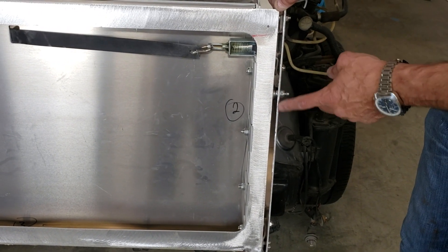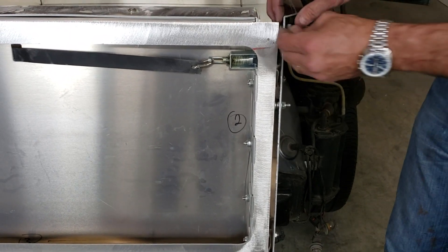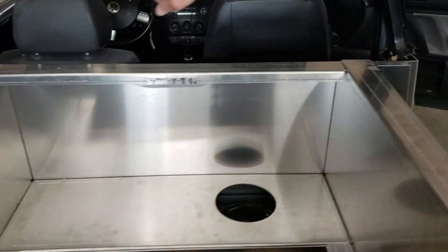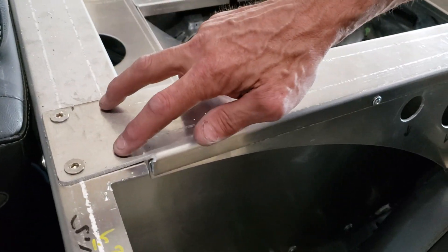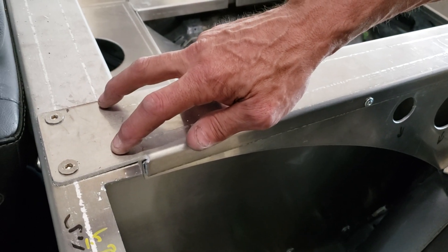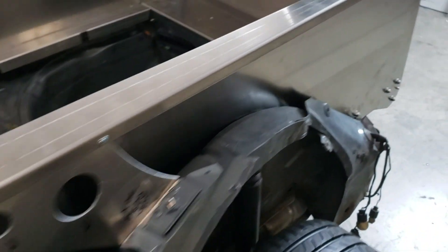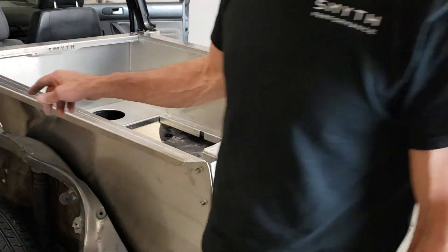Remember, this piece is square, and it needs to be square if we're going to line up the body. So you go right here — once you put a little shim or spacer, you can even take one of the bolts and put it in here just to hold the gap, hold the gap over there. Then begin tightening your bolts that you drill up front. To finish mounting this body, I put two flush mount fasteners and two more right next to them — a total of four fasteners under the rear surround on each side. Then I begin tightening all of the little tray bolts. This whole tray went on hand tight; we didn't really tighten the bolts until we had it in place. Once you start tightening, just keep an eye on the gap back here — this is the only gap that really matters. You can adjust it a little at the end, but you really want to have this gap perfect when you tighten all of your braces.